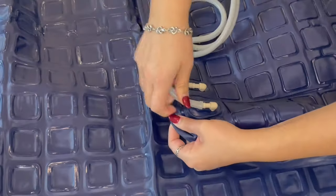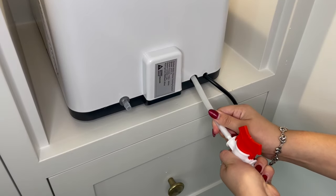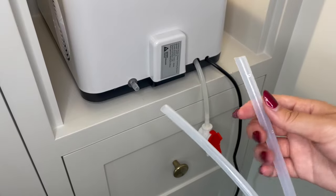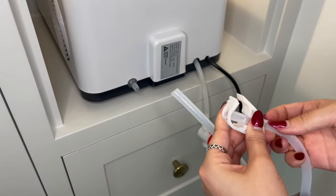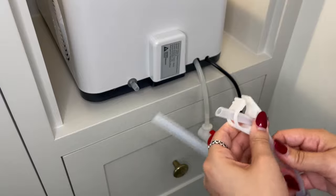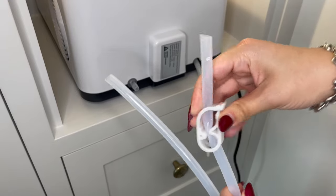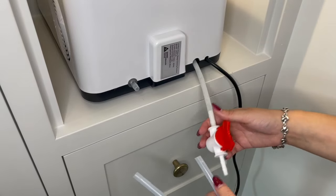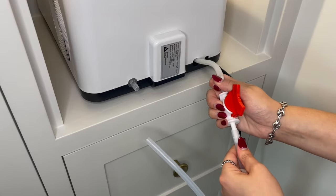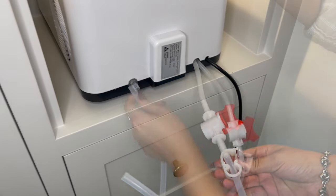Keep the side with the tube connection close to your mattress cooler. If you are using the PVC pad, attach the tubes to the water ports. Next, insert the shutoff valve into the water output port. Slip the hose clamp onto one tube — to close the clamp, simply squeeze it; to open it, pull the tab. Attach this tube to the shutoff valve, making sure the valve is in the open position, then attach the other tube to the water input port.